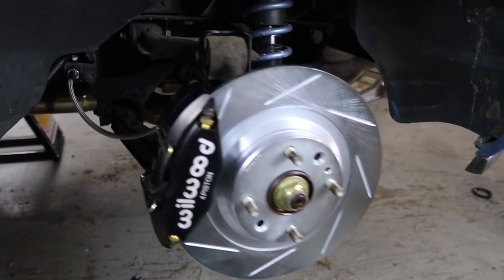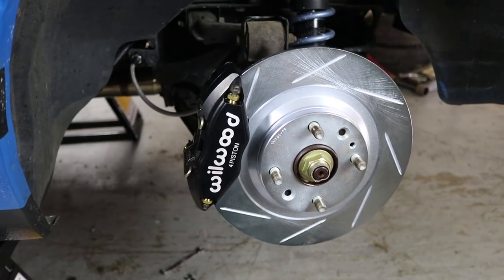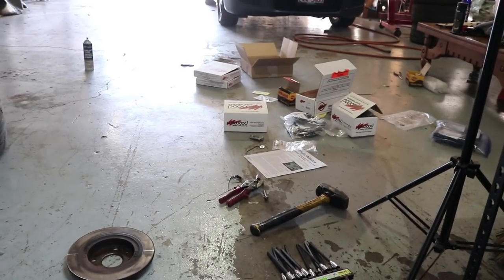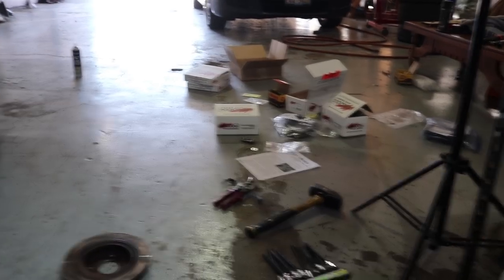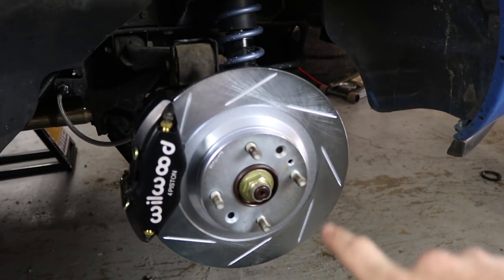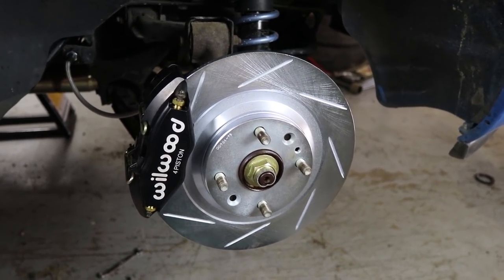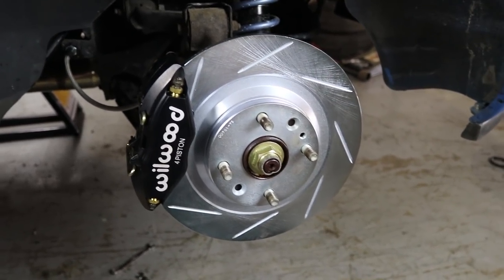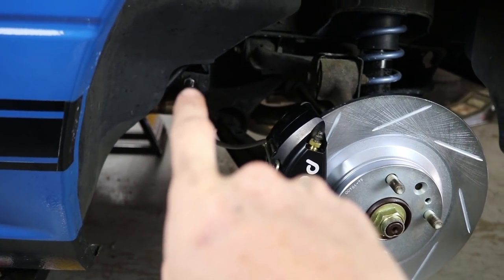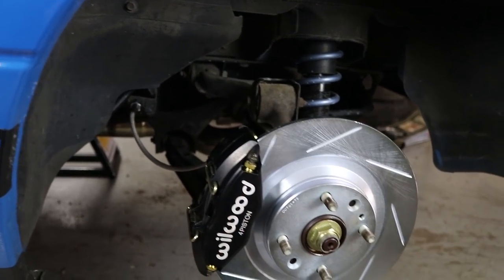This side is all done — the caliper's on, the rotor is on, the line is in. Now looking back there, you might be thinking where the heck is the e-brake cable. My answer is that it's nowhere, because I'm not using an e-brake with this brake kit. It is an option to get an e-brake cable — they actually included it in my kit even though I asked them not to. The problem is you can't use the stock e-brake cable, and replacing the entire e-brake cable just wasn't worth the extra effort. So I zip-tied the stock e-brake cable up into the rear subframe so it's out of the way and looks clean. Let's go ahead and do the last side and then we can get to bleeding the brakes.